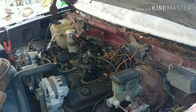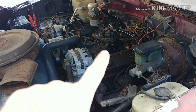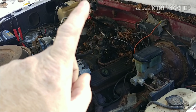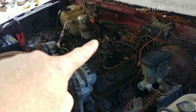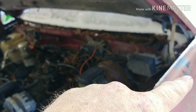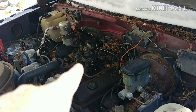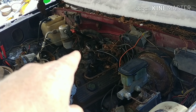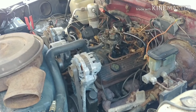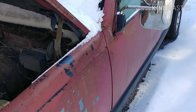I'm going to get the tire aired up, put those pieces on, then flick the key a couple times and go through the fuse panel. Maybe they tried starter fluid and burnt the wires, which could have tripped something making the fuel pump appear bad. We're going to start with diagnosis — fix the stuff we know is bad first. I'll replace the wires, then check the fuses, because if I pull that fuel tank and replace the pump and it was just a fuse, that's wasted effort. It's about 15 degrees out, so be right back.